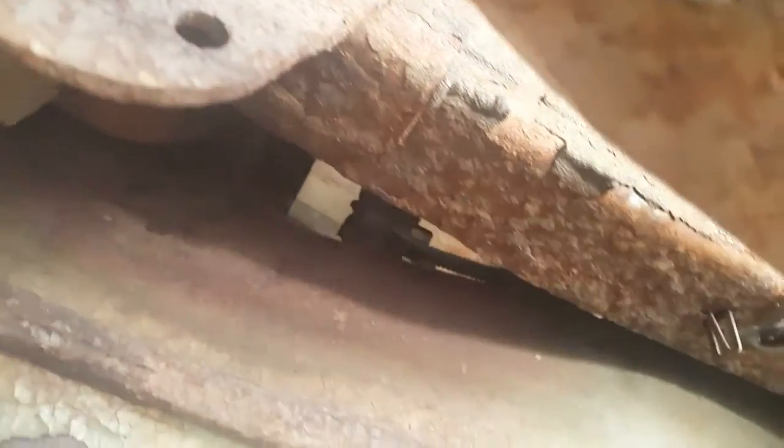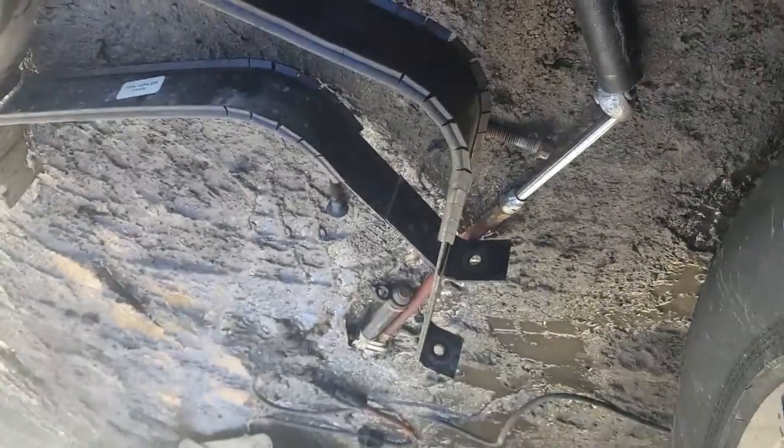This strap, this is a newer strap. I had a recall done a while back. Came out pretty easy. Bolts came out pretty easy. Like I said, they're 2 13s. Both of my straps. You might want to think about replacing the straps if you have not had the recall done. And then you're going to start dropping the tank slowly.